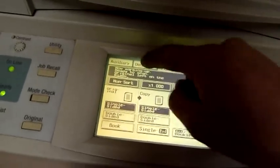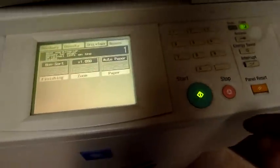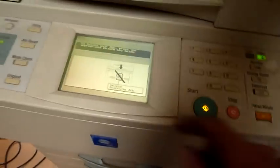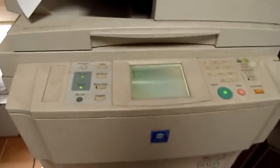I've been into service mode and tried playing with the toner feed settings and things like that and it still won't do it. Stop 00, Stop 01 or something — that might have been for a different model of machine, I can't remember now. This will scan to network as well, I think. They're basically a digital scanner on a big laser printer — that's essentially all the digital copier is. It's a glorified flatbed scanner permanently attached to a laser printer.